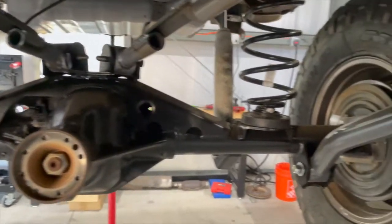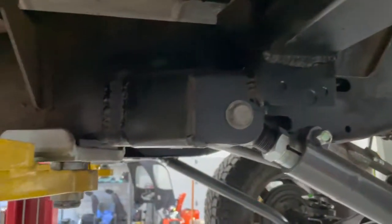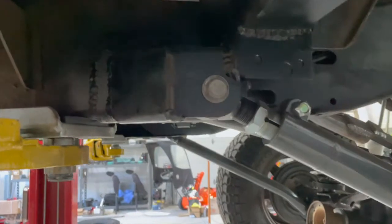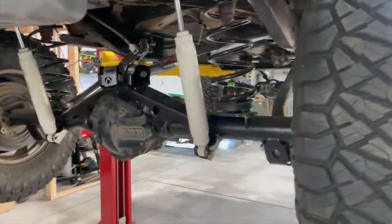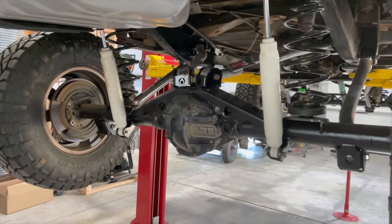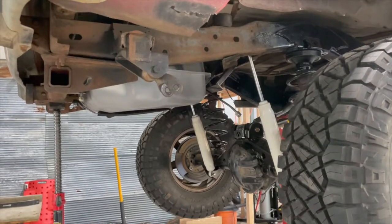I put an Artec truss on it with JK coil perches positioned where I need them for my coil — still figuring out exactly which coil I'll be using; it's all just test, not correct, take it off, try again. Synergy long arms in the rear — JK two-door long arms connected to some JL rock crawler long arm brackets, literally just picking up parts at the shop. Artec TJ coil perches worked perfectly; there's a bend right there that helps gusset it. I'll be doing some 1310 driveshafts to get them lined up, new shock brackets, and Fox shocks once I figure out the right height and which shock I need.